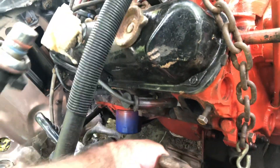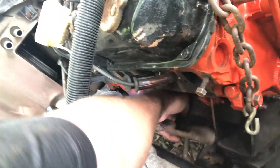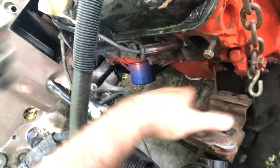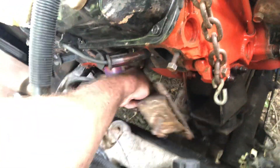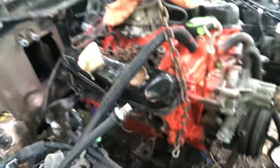Let's get back up here to the motor mount situation. These are the mounts that come off the Crown Vic motor. My idea — brainstorming here — I can turn them like this, cut that stud off, weld that to the frame, run a plate down through here so I can bolt the motor mount like that, and weld the mount to the frame over here. Let me know if you think that'll work or if you've got any ideas — help me out.